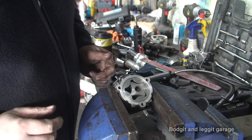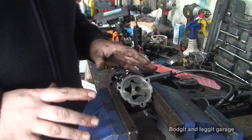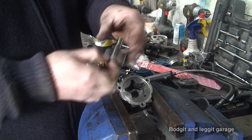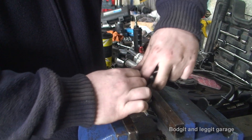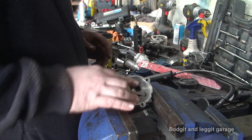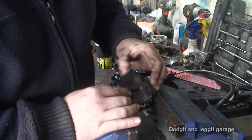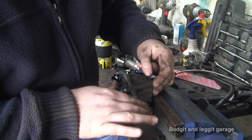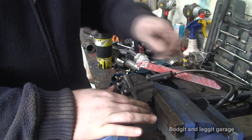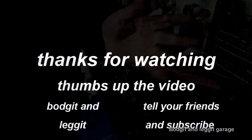That's essentially an oil pump. Most cars are more or less the same — just different shapes. If you checked everything and it's all within tolerance, don't put it back together dry. Take each part out and put oil all over it, inside and between everything, to give the pump that extra bit of help on first startup. Oil everything, put it back together, and as long as your tolerances are fine you'll be sorted. Unfortunately this pump isn't going to be okay — the oil pressure will be too low. But anyway, hope it helps — thumbs up and subscribe, and get your hands dirty. See you for the next one.